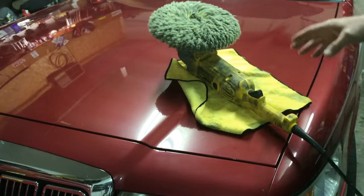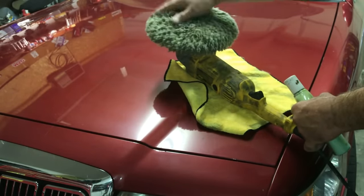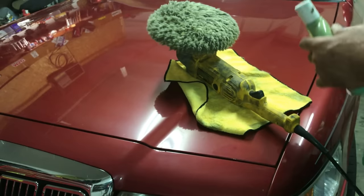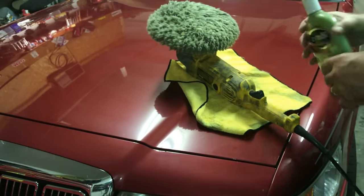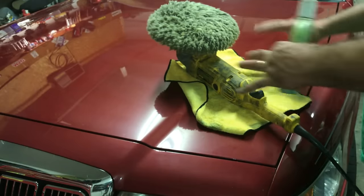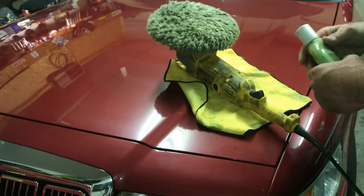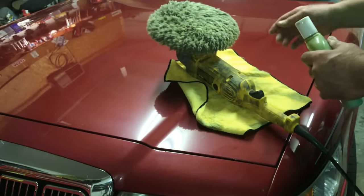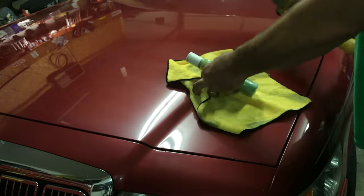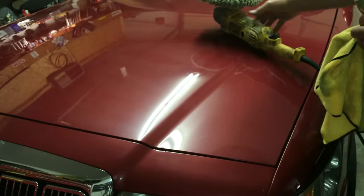Here are a few clues when you're buffing: do not do it on a hot car, make sure you're in the shade, and try to do it in the morning when it's cool. For those of you who've had the product dry up on you and the buffer start grabbing — that's because you're trying to do too big of an area. I'm going to do this as a beginner should do it, not as I would do it, because I would do half the hood at a time.